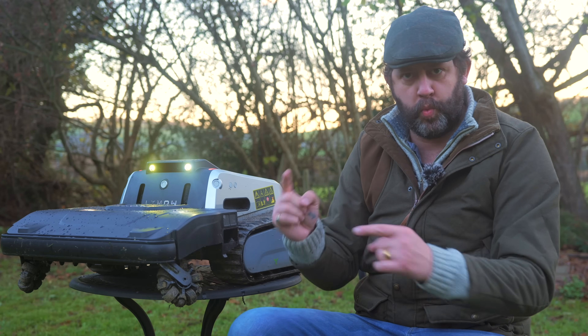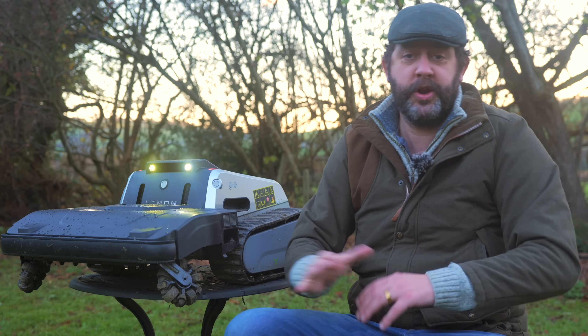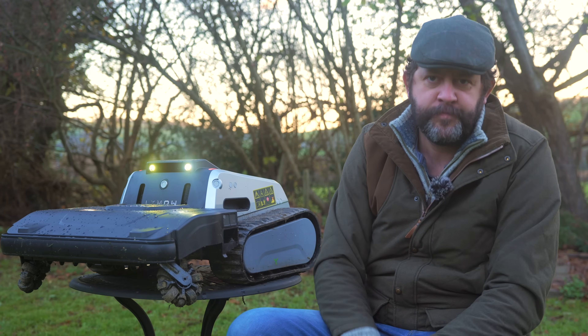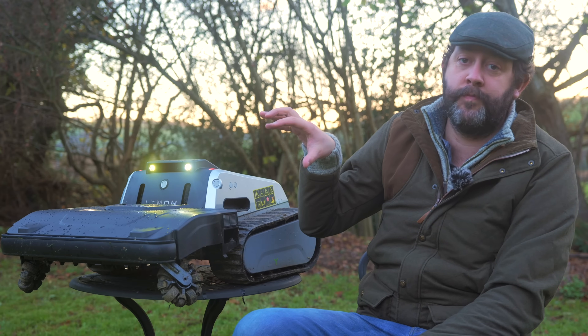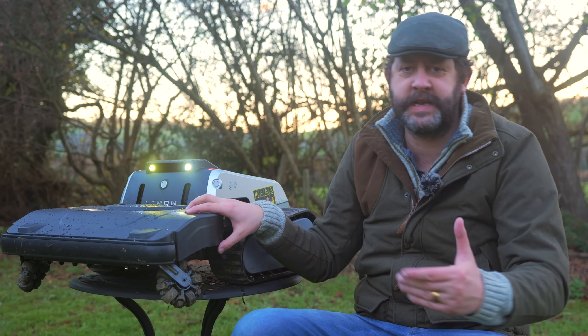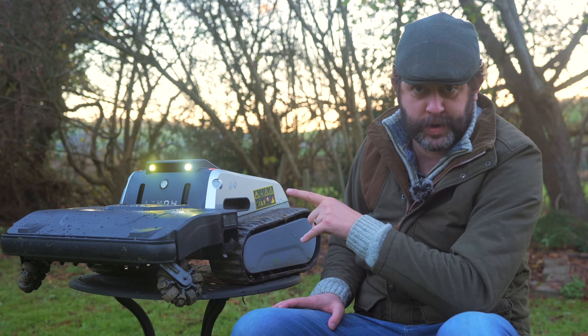With the Limo One it's not just got one lawnmower blade, it's got two - so don't expect it to be a silent butler in the background. It's going to mow your lawn and you're going to know it's doing it. Another point is that the blades are heavier and face a lot more resistance all of the time rather than just the outermost razor parts of the razor design. This means battery life might not quite be as good as in simpler robots with the razor style cutting disc.